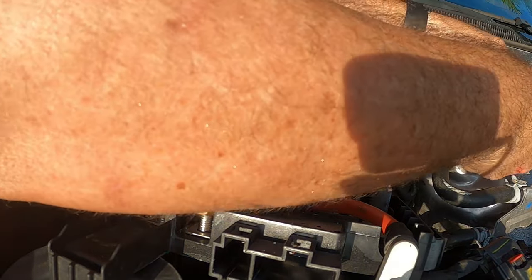We had a little issue with the camera not working, but I put the bolts back — terminal two and terminal three as marked. Put the positive cable in following the mark. There's only one way — you have the small and the large, so it locks back in. It has tabs on the sides which correspond with the tabs here. Set your thing in, lock in, push in and you're done. You've got your hose back in, got your drain hose, got your cap. We didn't lose any coolant in the hose so we're just going to add some now.